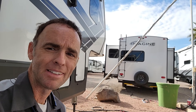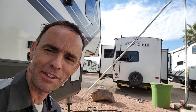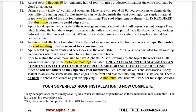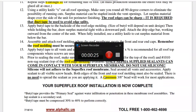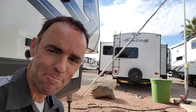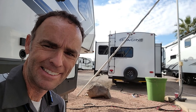I brought up the concerns about it being wrinkled. They told me wrinkles are common and normal — I think that's wrong. I went through the installation instructions on Alpha's website and it's the exact same way I normally install membrane roofs: it should be adhered down. Grand Design says it needs to be loose so it can flex and float and not tear. That does not sound correct to me either, because if the TPO roof is tearing, that means the deck below would be folding in half. That's my concern — I don't think that is correct.